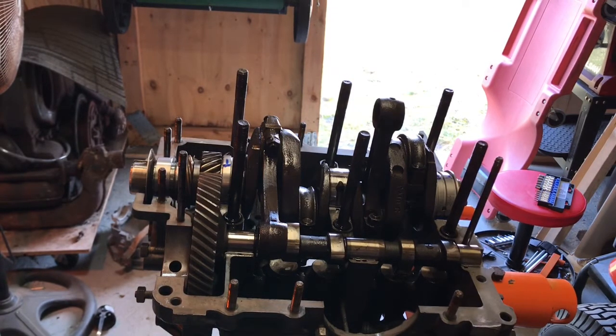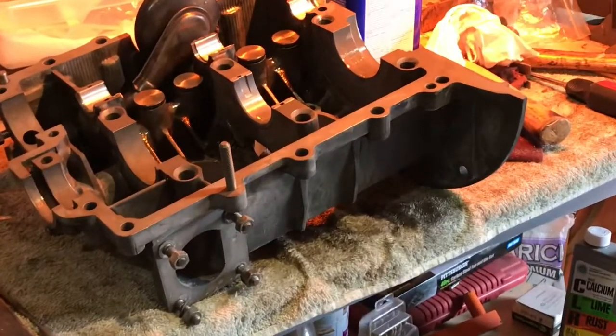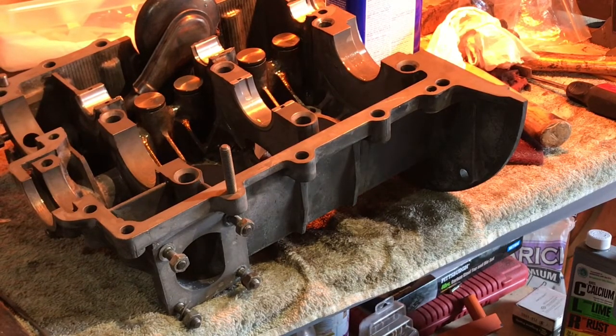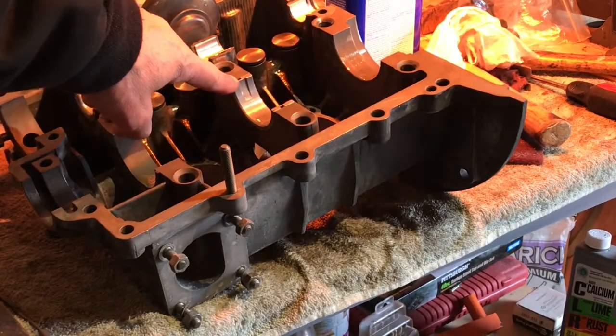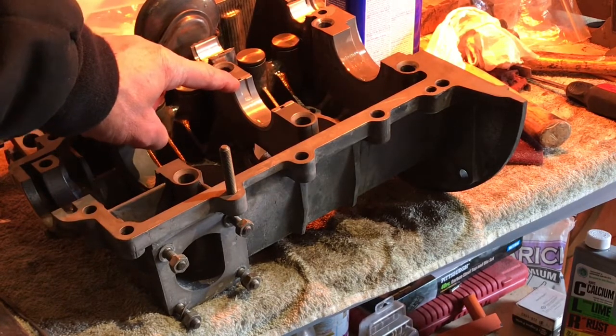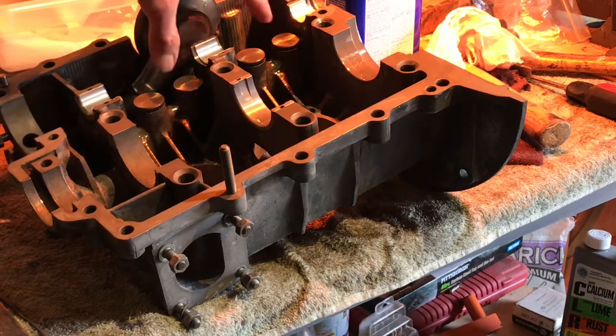So our goal is to take that other half of that engine case right there and slide it over our other half section, which is mounted on our engine stand. Reminder, make sure you install your other half of your number 2 main bearing for your crankshaft. Make sure you don't forget to put your bearings for your cam follower along with your lifters.